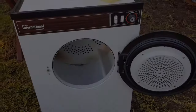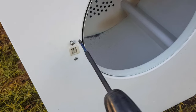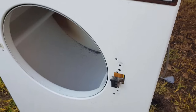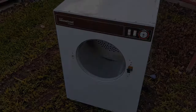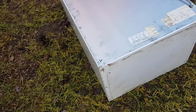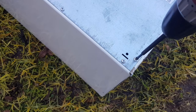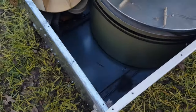We'll start on the front section — just pull out all the screws you see, and then we can do the rest from the rear. I've pulled off everything from the front. Don't forget the screws behind the control knob and also the door switch, because if you get everything off from this side now you won't have to turn it back over again. Some dryers have a removable top panel — all makes are different — but I like to keep the box complete, so I'll take the back panel off now and basically gut it.